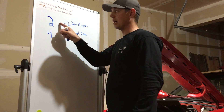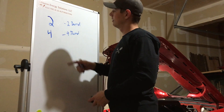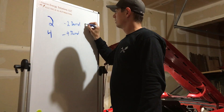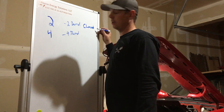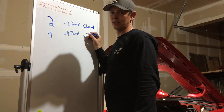The two barrel closed chamber heads — with no dot — are the ideal ones for lower RPM. So if you find a head that's got just a four or a two on it with no dot, that indicates it's the four or two barrel closed chamber. Those heads are going to give you a lot more performance — the combustion chamber design is a lot more ideal.